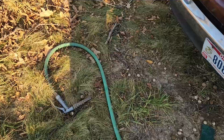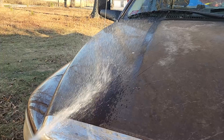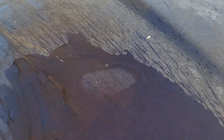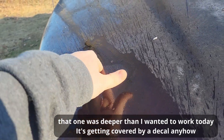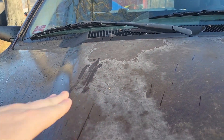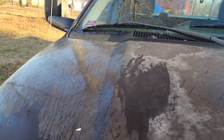Now, what I was saying about the water — if I go down here and I grab my hose and I come to any panel, let's just say this hood. What's this hood going to look like when I'm done? Let's spray some water on there. That's the difference we're going for. We're going to have a new gloss finish — we're going to go from this to this. Even after I've sprayed that, we can see that blemish right there. That's what we're trying to sand out are these blemishes. You can feel it with your finger — moisture is able to get underneath there now and it's causing the paint to lift. So we need to sand that out. Sand all these blemishes away, so that way when we do take some water and go across there, we don't see as much of it. And once we get to that depth, that's where we need to be to clear. So we're going to keep sanding all this down.